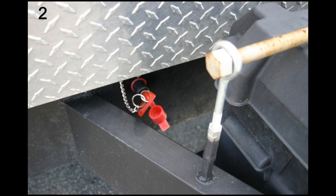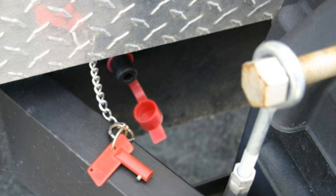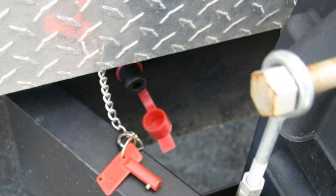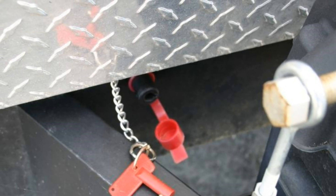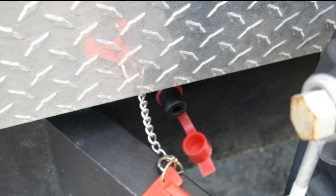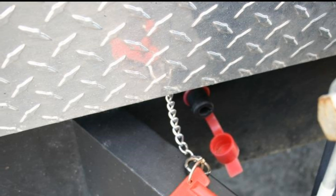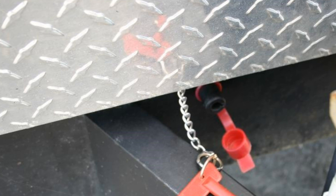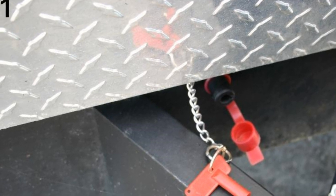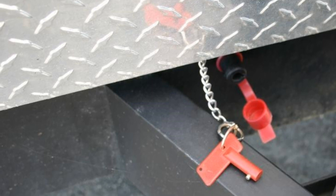The switch only shuts the battery power off. When you leave your trailer, all of the power is shut down — even if you're at a park or on vacation and you go to the beach for the day. The kids can't have left a light on that will drain the battery. You really don't need 12-volt power while you're away. If your fridge is running on propane, it doesn't need power. For approximately $13, you can buy and install this switch and save yourself the heartache of coming back to dead batteries.